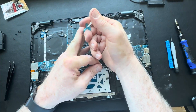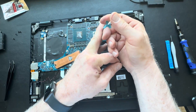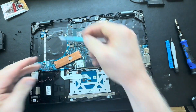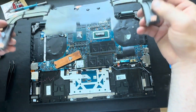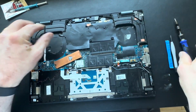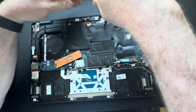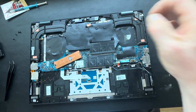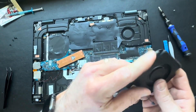I'm going to apply thermal grease here — try not to put too much on. Add it evenly across the surface of the GPU and CPU. The heat sink will spread it the rest of the way when applied. The key is making sure you don't forget your thermal grease, as you could have overheating problems. Re-tighten the heat sink screws in the numbered order — most heat sinks are numbered one through however many screws there are — to help evenly distribute the thermal grease.